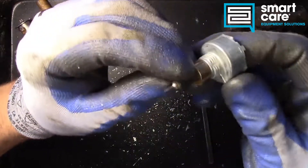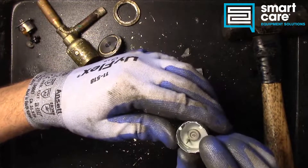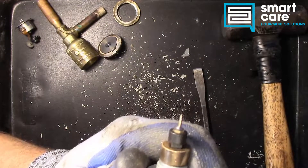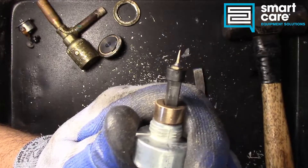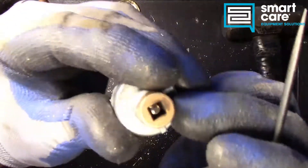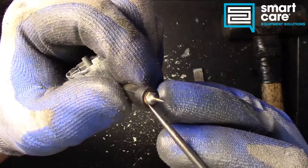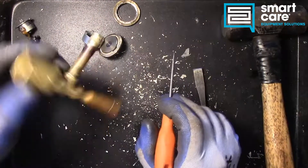Now let's take a look at the mechanism. We've got one of our clockwork gears. As I'm turning this, you can see that pin will retract and advance. Let's see if we can advance it all the way out — and there it goes. This whole mechanism is just a little screw and a threaded plastic piece in a brass guide, and the gear down inside just drives that screw. The little pintle here is just threaded into a brass insert that's molded into this threaded extension. Pretty neat little setup.